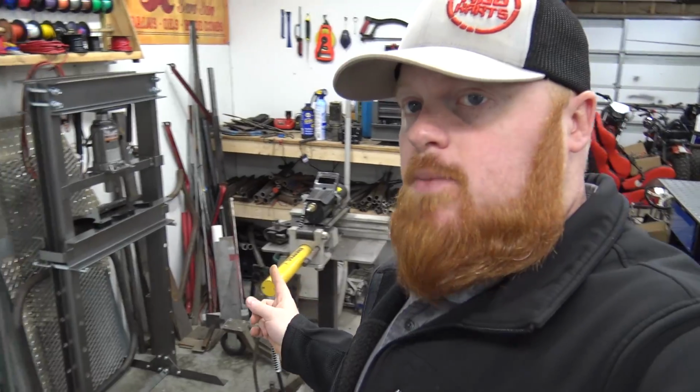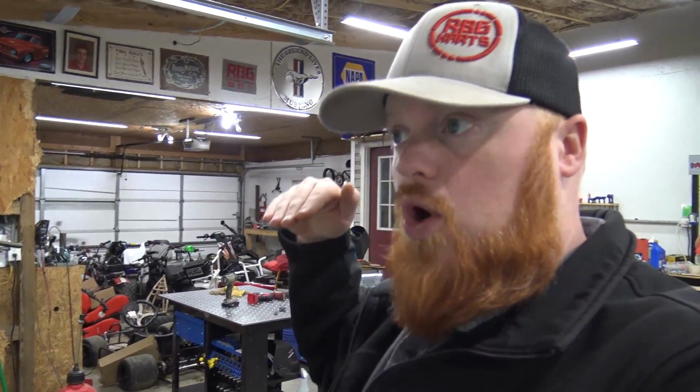Now, some people were saying, am I going to brace that rear rack a little bit because it is taking all the rear suspension? Yes. Basically, I'm going to take some 1-inch tubing and get it rolled. I do not have a roller. We're buying a roller very soon. We have a bender, but I don't have a roller. A roller will basically put a roll to some tubing. I'm going to roll some 1-inch tubing and weld it in there to give it an extra little brace.